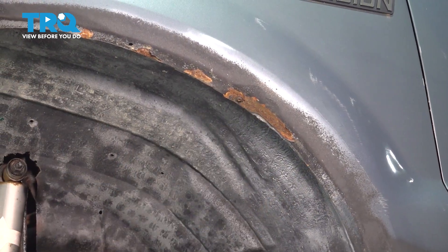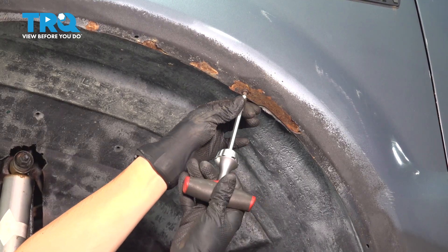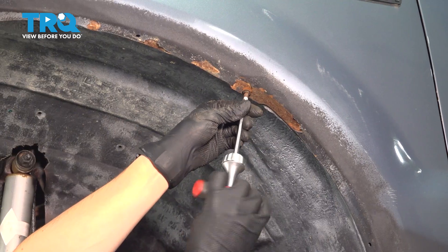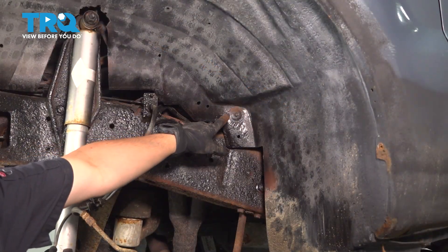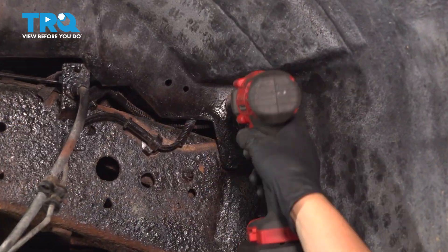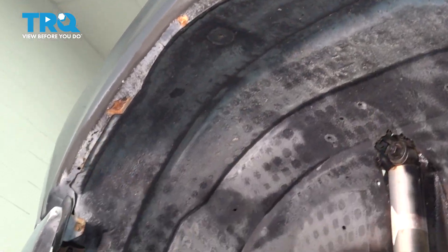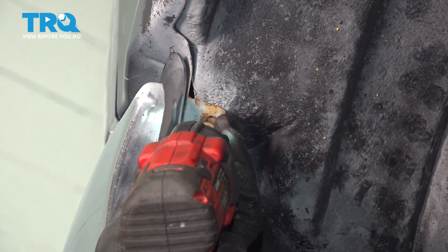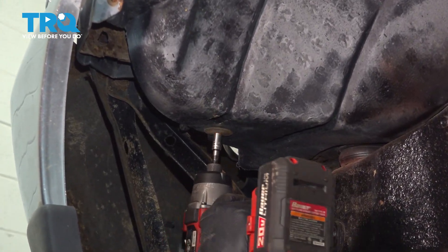My next one is actually a Phillips head, but it's supposed to be a 5.5mm just like the previous one. On the inside right here there's an 8mm headed screw or bolt — remove that. Keep following the edge along and you'll see another 5.5mm screw at the front, and further in the front underneath the fender liner an 8mm headed screw.